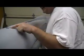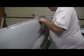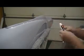I have all my places filled and I sanded them — they feel pretty good, but I'm gonna hit them one more time. My plan was not to get it perfect the first whack; you never can get it good enough, always gotta hit it again. I made a little sanding block for that job. I tried sanding it at first, but this hard rubber won't sand, so I stood it up on my band saw and went around to get the shape so I can get in there and sand it flat. I'm gonna take my favorite thin bondo — comes in these tubes.